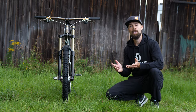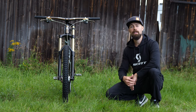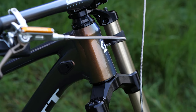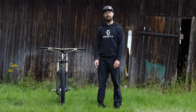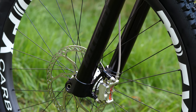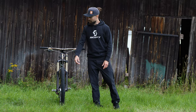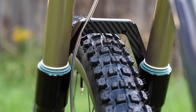The extension also holds a special bottom-out system which allows you to separately fine-tune the last 20% of the fork's travel — perfect for a hard-hitting bike like this so you don't bottom out too hard. While it's easy to think this is just about crazy looks, it's really about performance. Still, personally I think it's a great looking fork. Another really cool feature is that the lowers are not cast like on regular forks — everything is CNC machined, from the lowers to the dials. It also has a cool system for fastening the brake hose with a carbon plate that you screw onto the back of the arch.